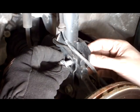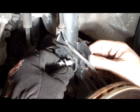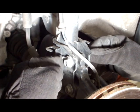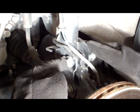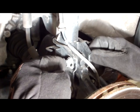Install the Easycam bolt into the strut hole, making sure the formed upset on the washer is in the hole and the washer is flush on the strut. Install the formed upset washer with the large tab facing away from the wheel for negative camber, or out towards the wheel for positive camber change. Add the locking nut and snug, but do not tighten.